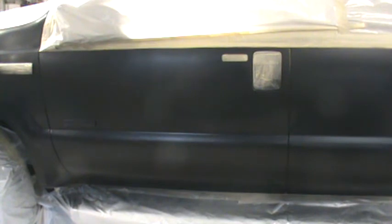You go one coat of the high solid, or you can go two coats of the medium solid, however you want to do it. You know, you got a bigger investment when you buy the high solid kit, of course, but it does stretch a lot further. And you know, when an ice job does come in, you have the ability of putting some clear on there that has some mils per coat. And usually the more expensive, better clear has more of the UV protection and stuff like that in it also.